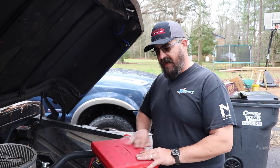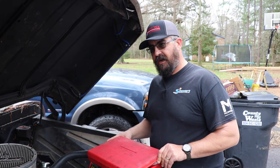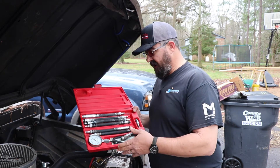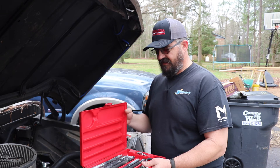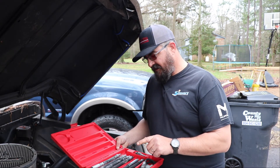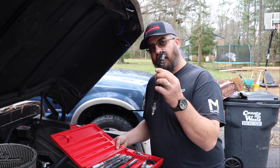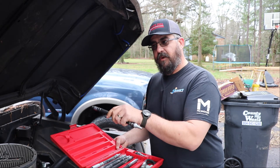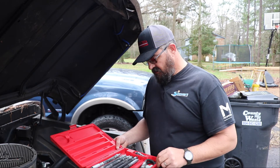What I used for the compression test was my Snap-on compression tester — this is an old one, actually given to me by my father-in-law. It's a pretty complete compression tester with a bunch of different leads — the small one and the gauge — that I was able to screw into the spark plug hole. The nice thing is I can take the lead I used for the compression test, which has an air nipple on it, and when I go to do the valve stem seals I can screw this into the hole, take the valve spring retainers off without the valves dropping down into the cylinder, and replace the valve stem seals. Multi-use — at least in theory, that's how I hope it works.